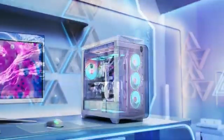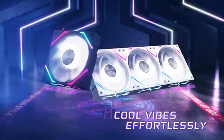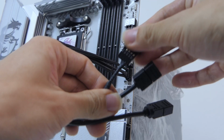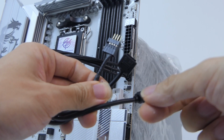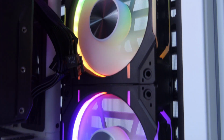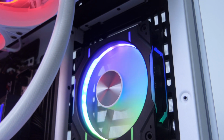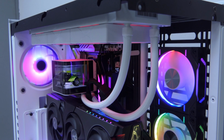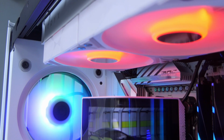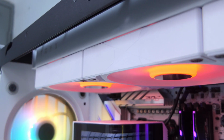So essentially what I think is this one cable, which allows you to connect one fan, saves up one fan header and one ARGB as well as one USB 2.0 on this motherboard, because it is a one-size-fits-all cable. I believe other fan brands should also work with this cable, which I have to test, I'm not very sure. And I also think that it will work with AIOs that require ARGB, a fan connector, as well as a USB 2.0 to interface with the motherboard. So all of these things require some testing, and I'll get back to you when I have run it on this motherboard.